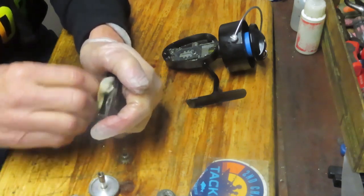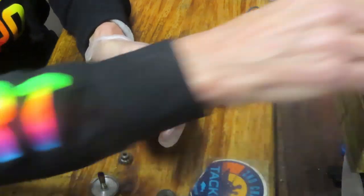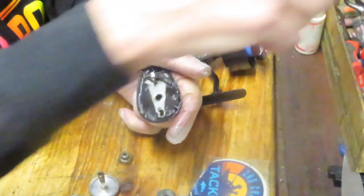You'll see why it was pretty difficult to get out — there's a whole bunch of old grease on there that's acting as a glue because it's all dried up. We're going to take penetrating oil and a paper towel and wipe all that old grease off. Be careful — if you put that washer back on, leave it there. Don't wipe it away with the rest of the dirt and debris.